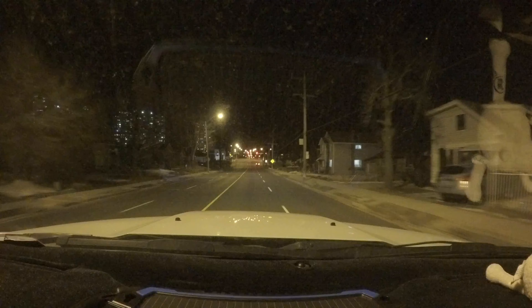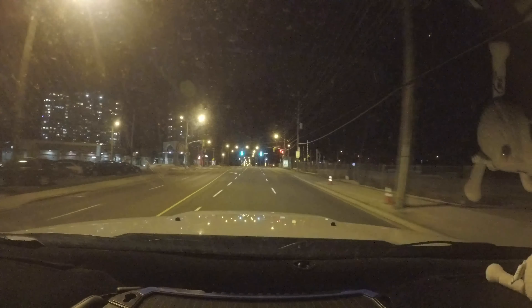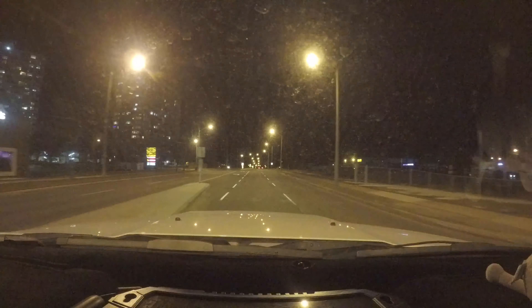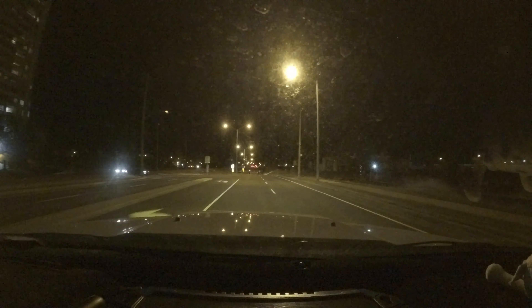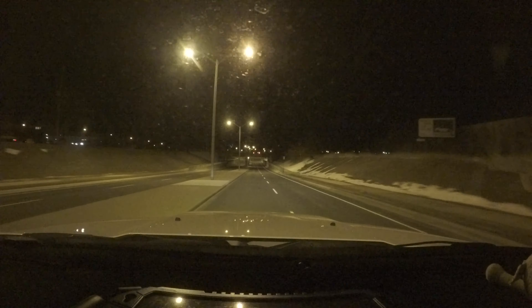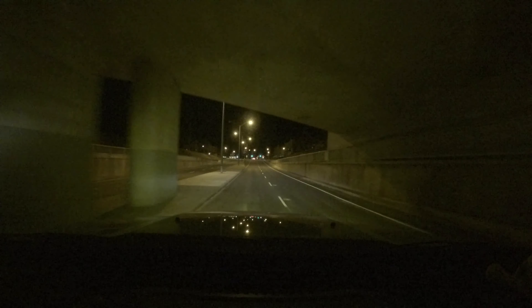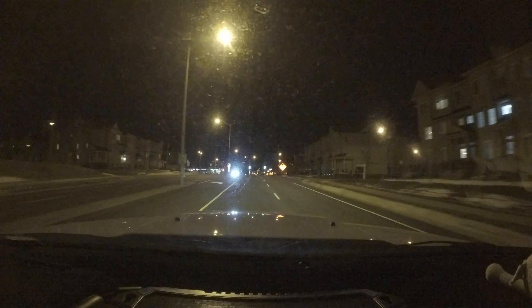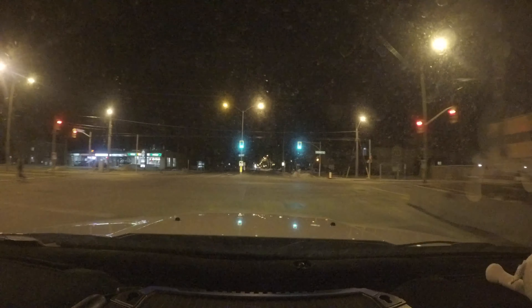That vehicle was never designed to be a great towing vehicle. I was really at the limit of what it could do, and one issue with the electric-only fan was the heat cycles — the fan didn't come on until temperatures got up to a certain point and then brought everything back down. Towing with a vehicle that only has an electric cooling fan means it has a minimum and maximum temperature threshold before it kicks on. One good thing about this vehicle is that the mechanical fan, via the viscous clutch, is always drawing at least some airflow through the radiator. Even at very low speeds, when the engine gets hot, that clutch engages and constantly pulls air — which is exactly what you want.